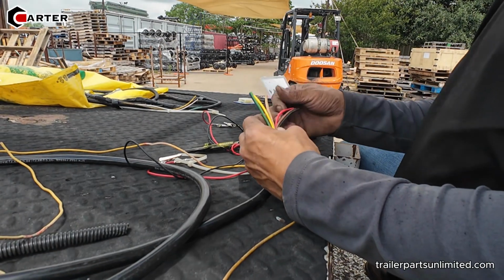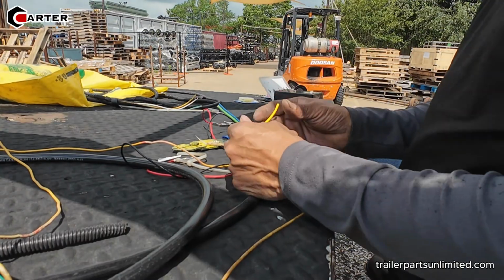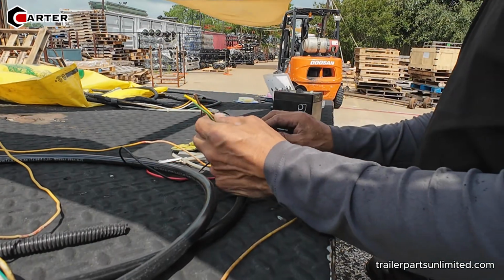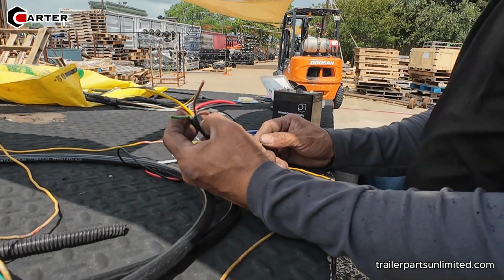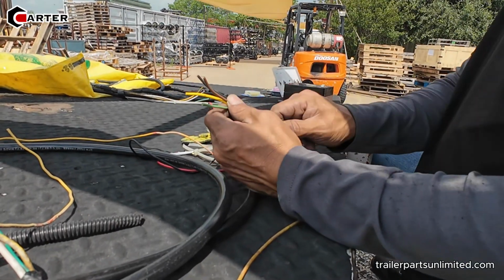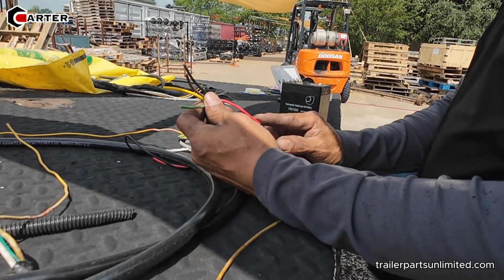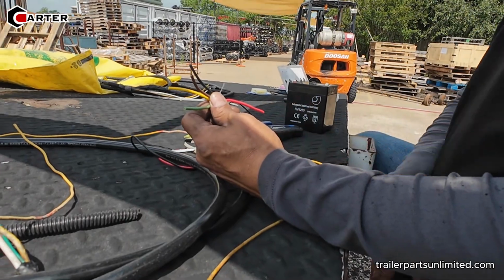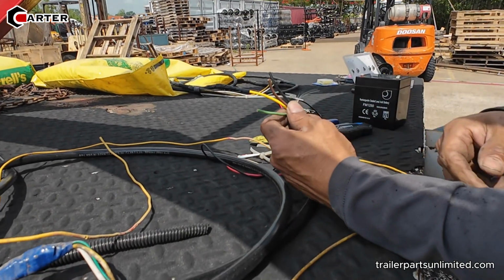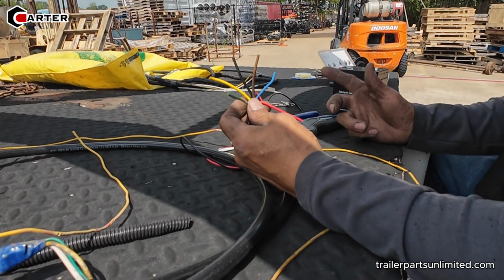Okay. So this type of wire, like a six-way wire, you use the standard color code, just like I say: green, yellow, brown, these three, and white. But in the six-way, sometimes there's a black, so people use the black for the ground. Okay. So the red wire you use for the battery charger when you get the breakaway switch. This one plugs straight into the auxiliary wire. It's constantly powered on and charging the battery all the time when I plug in the trailer. The blue is the brake, it just goes to the brake.